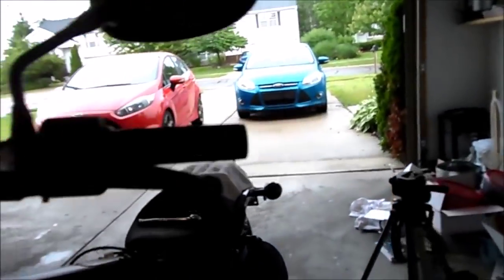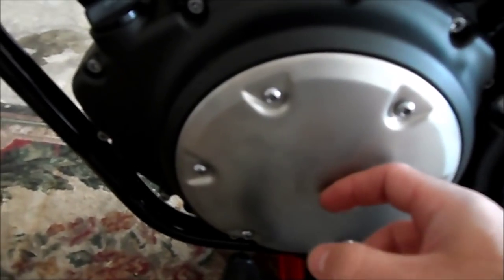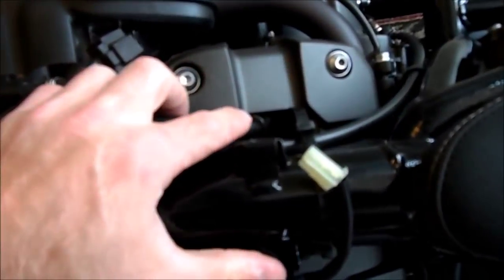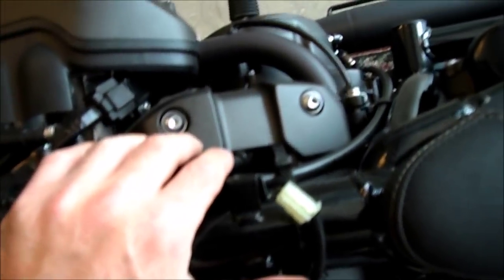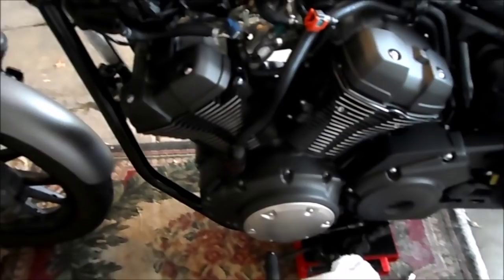Make sure all the connections are good. On the tank there's a little loop — the hose goes through that loop — you want to make sure you put it back the same way. So these are just plastic covers here and here, and I'm going to take those off. I'm also going to take off this plate right here. Behind this you can put a wrench on the crankshaft. If your bike didn't have something like this, you could pull the spark plugs, put something in there to tell where top dead center is, put it in 5th gear, manually rotate the rear tire, and you'll see the screwdriver go up and down as the piston goes up and down. That's one way to find top dead center, but there's an easier way that Yamaha engineered into this bike.